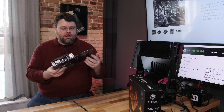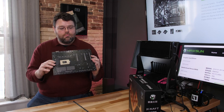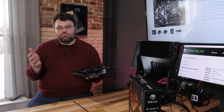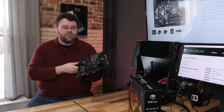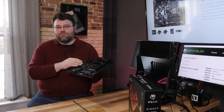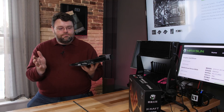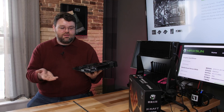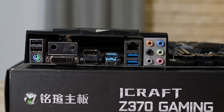I'm not really sure what this motherboard costs compared to competing brands depending on your region. I would just be cognizant of the limitations: you're not going to run x8/x8, and the PCI Express x4 connections are through the chipset. If you're not going to run a lot of peripherals, those things don't really matter. If you're just going to be overclocking and want to run RGB, this is a perfectly suitable Z370 motherboard. Let's take a look at the rear I/O.